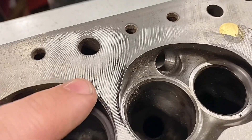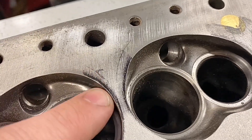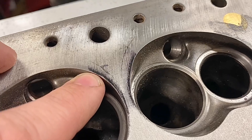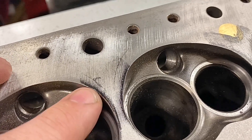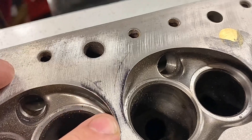This is how you add reliability when you're building your engines — actually make sure all your mating surfaces are perfectly flat and your gasket joints are nice and flat, and you've got maximum contact.